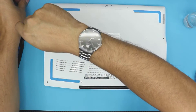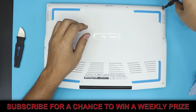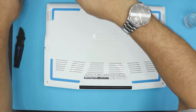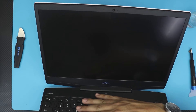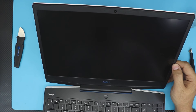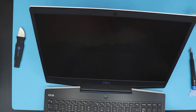There we have it — that's how you repaste and clean the fan and the heatsink. Once you finish, if you unplugged your battery, plug it back in. Grab the bottom cover, shove the back end down where the hinges go, push it down, and make sure you hear those clicks — the sides, the sides, the front. The last thing is put the screws back in. You don't have to go really hard on the screws, just nice and fair. I hope you guys liked this video — if it was helpful, I appreciate if you click the thumbs up and subscribe. Leave any questions or requests in the comments and I'll try to answer them as soon as I can. Thanks for watching and I'll see you in my next video.